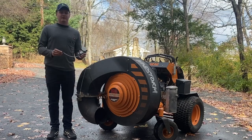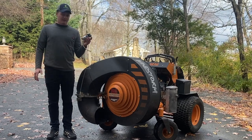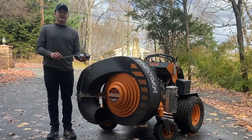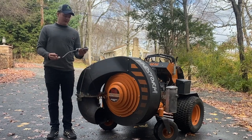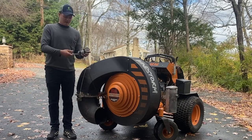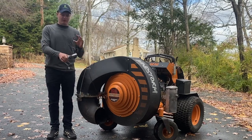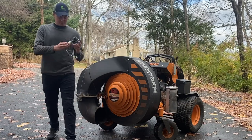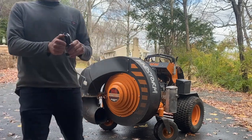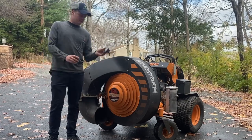If you have a Skag Windstorm and you're not familiar with this piece, or if you don't even have one and you're planning on getting one - this is the motor that turns the nozzle in the front. We had one fail at about 90 hours. We got a new one, but I was thinking this is a car window motor that Skag took from someone else and made it to fit theirs. They own this part number - 486671 - and they probably have some sort of ownership over this part, but this is a general part for the most part.